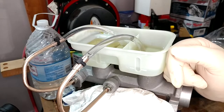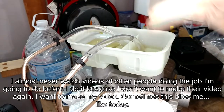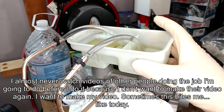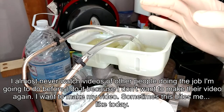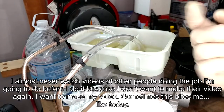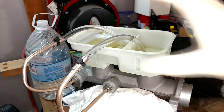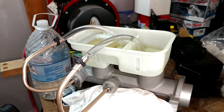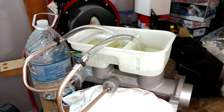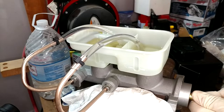I think this might be a case of me just not knowing my vehicle very well. I've looked up several videos of other people bench bleeding these plastic reservoir GM-style master cylinders, and they all have the geyser thing happening in the rear reservoir. I've looked up plenty of videos of the old-school GM ones with cast iron or cast aluminum reservoirs, and they don't seem to do the geyser thing. I think this behavior is normal, but the internet being what it is, I found reports both ways.